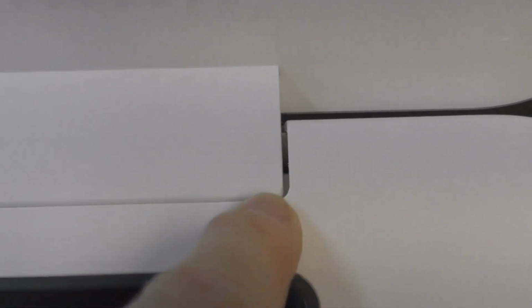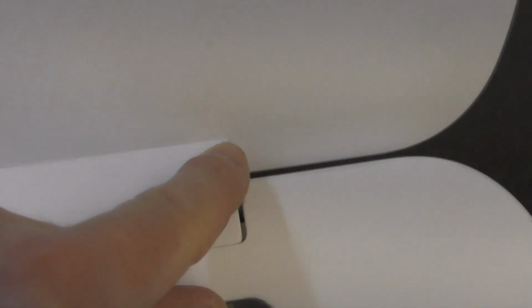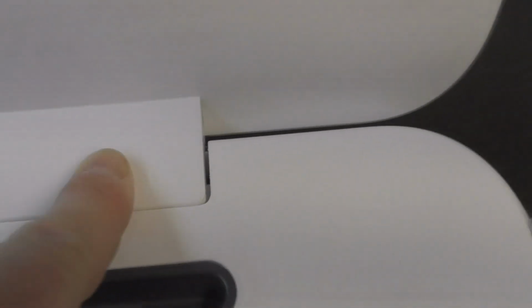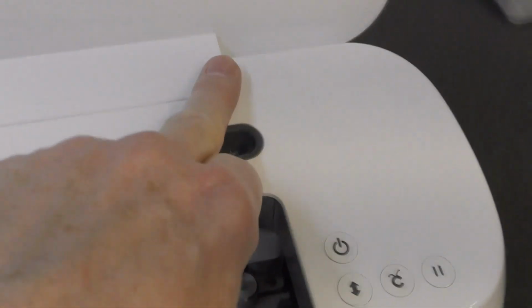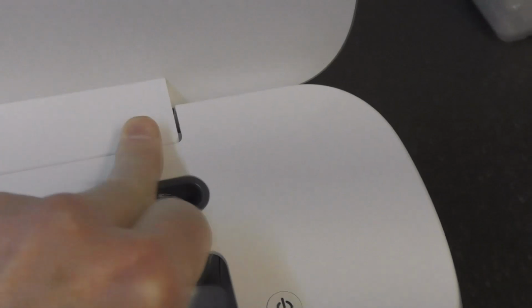But yeah, if you just flex that lid forward a little bit, you can see where the join is. Probably can't on the camera here, and that slight split where the join is, where you need to get your spudger or blade or whatever in there, and obviously start from this end, because a different person that's assembling this may well put superglue at the other end or all over the place. Very, very disappointing to see that, plus the lack of availability of these parts. Torx screws that are going to put off your average customer